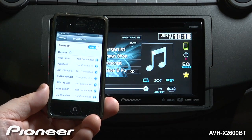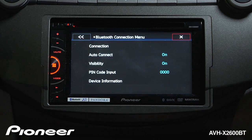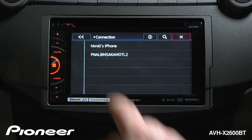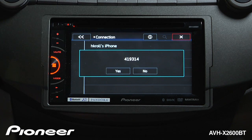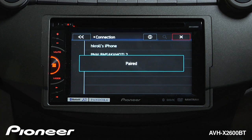Once we know we have Bluetooth on, let's touch the phone button on the radio and we'll touch the gear setting here and connection. We'll hit the magnifying glass to search for devices. Here's my iPhone — I'll touch that. We'll say yes here and we'll confirm that on the iPhone. Now the two devices are paired.